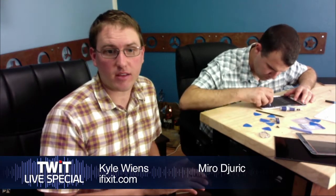Is there anything special they're doing for heat dissipation on this? Yeah, so the interesting thing with heat dissipation is that the battery life is directly proportional to how hot it gets. So if you have your phone that's running hot all the time, your battery isn't going to last as long. In terms of months. Oh, that's funny. I thought it was running down because it was hot. I mean, that it was hot because it was doing something that was running down the battery. But in fact, it impacts battery life to be hot. It impacts battery longevity. So you've got battery life, how much you're going to get in a given day. And then the higher temperature the battery is over time, it degrades the chemistry. Ah, that makes sense. Okay.